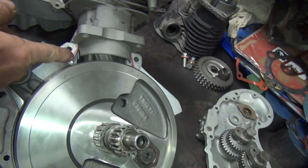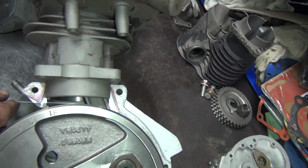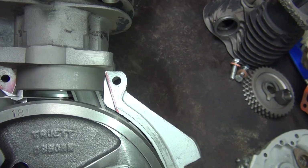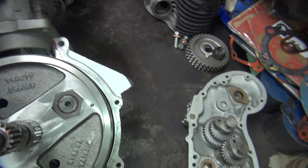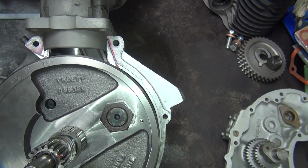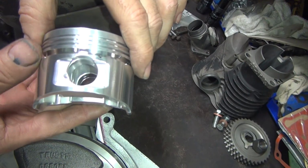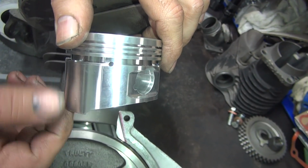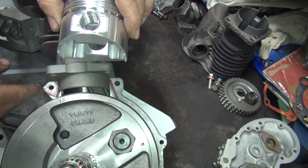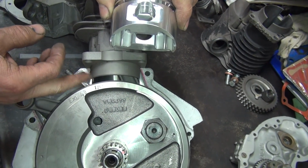So you got about a 200 thou gap between the cylinder and here. The piston was about here, so the piston's actually going to pop out about a 1/16 out the bottom of this, even though it's shorter than the other piston. Because this has got a little short skirt. So I had the piston made, I had them shorten the skirt up, because there's no real reason to come out the bottom a whole bunch. That's still enough skirt for the bore, plenty of support on the piston. One advantage is that allows you to have more windage, so when the pistons go around, the oil and air can get in and out easier, so it doesn't suck up as much horsepower.